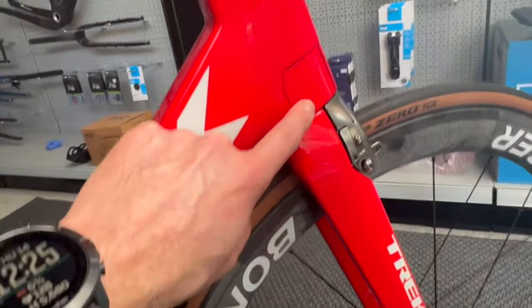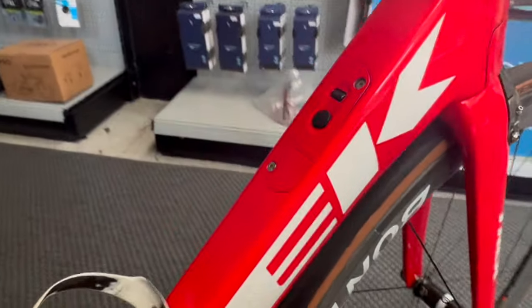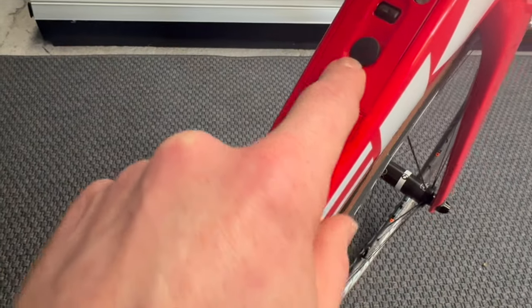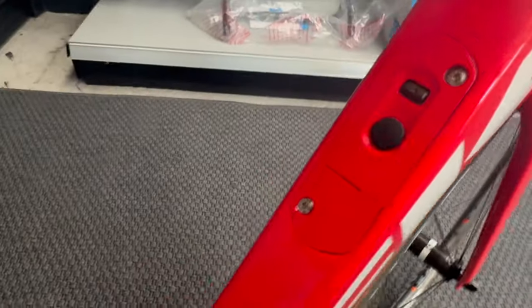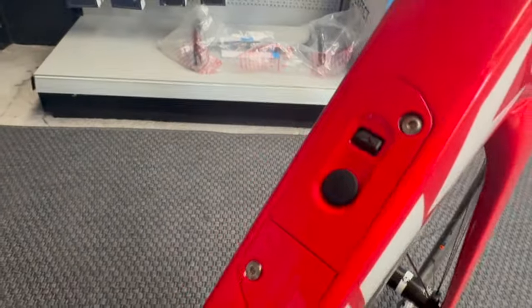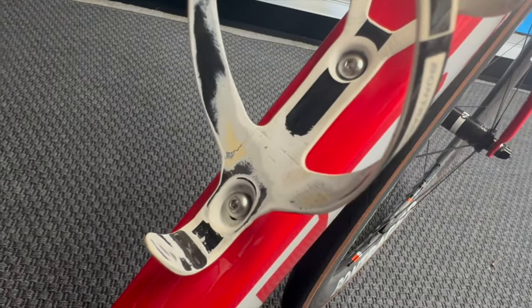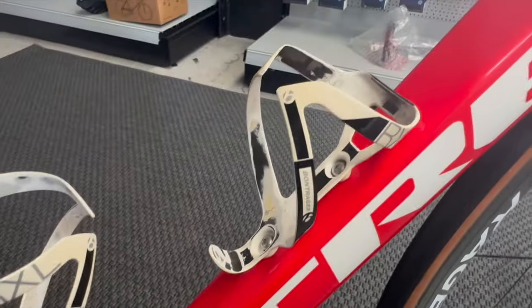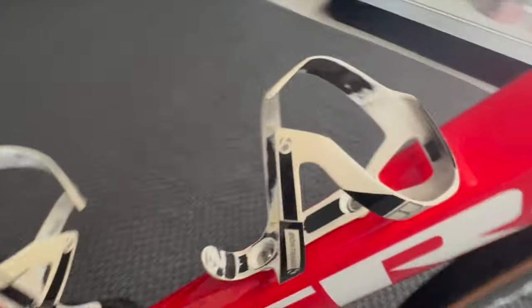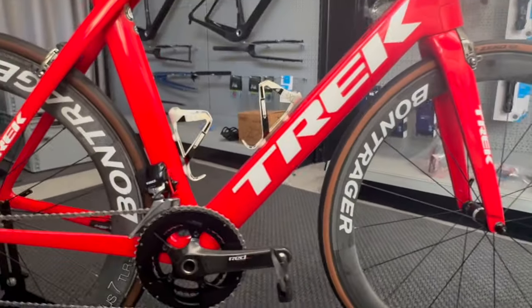That's probably everything on the cockpit. We've used our silicone compound on all the bearings to stop them creaking. Little details like this open hole — we've put a 9mm rubber bung in it to seal it. There are also little cracks there which I'll point out to the customer. Blocking that hole is important to stop water getting in. We changed the bottle cage bolts out for brand new stainless steel ones with locking washers. I will point out the cages are looking a little bit tired, so it might be nice to change them over — personally I'd put black Elite race cages on. But those carbon Bontrager ones are on there for now.